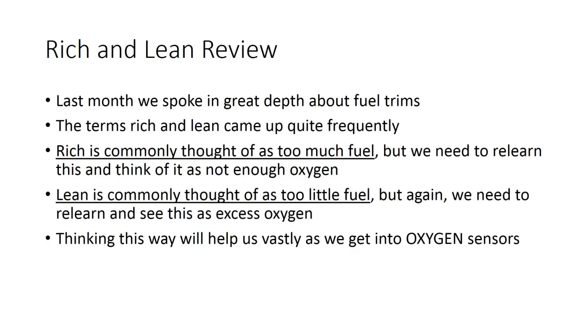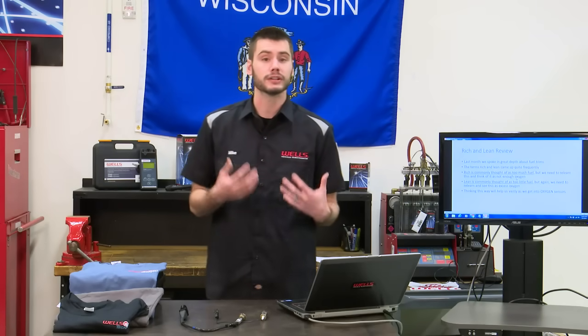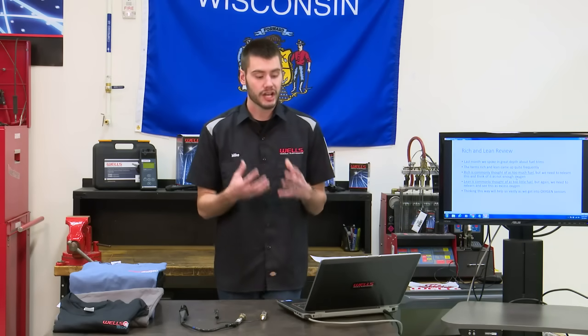So rich and lean review. Last month we talked a ton about fuel trims, and rich and lean came up frequently. Now there's this common misconception out in the industry about rich and lean. Rich is commonly thought of as having too much fuel in the system, right? Too much fuel entering into the exhaust system afterwards. And lean is commonly thought of as having too little fuel, but we need to change our mindset on these.